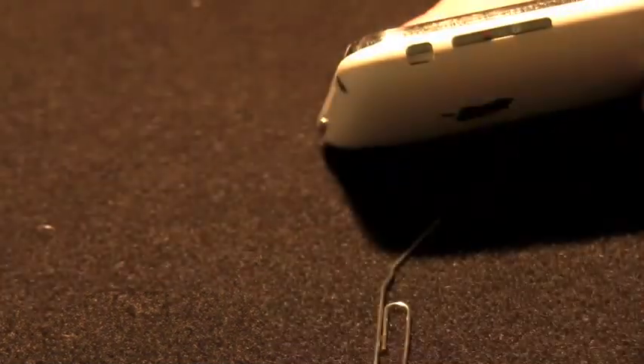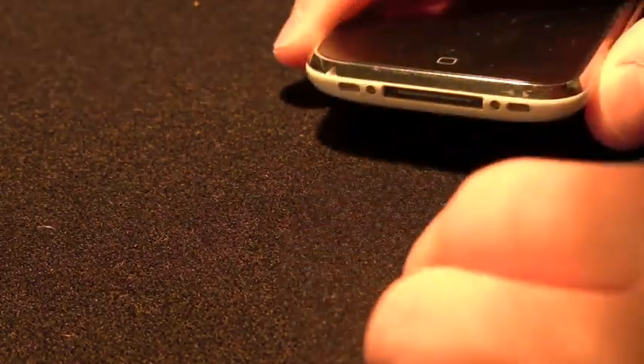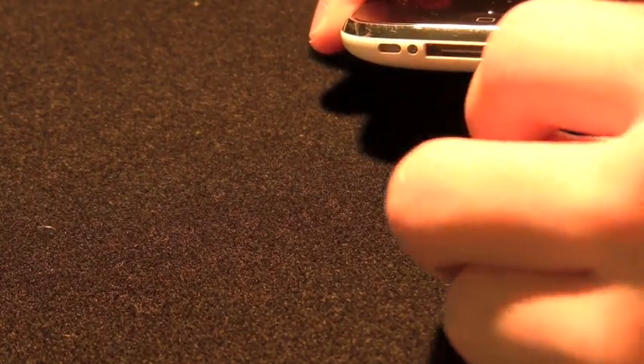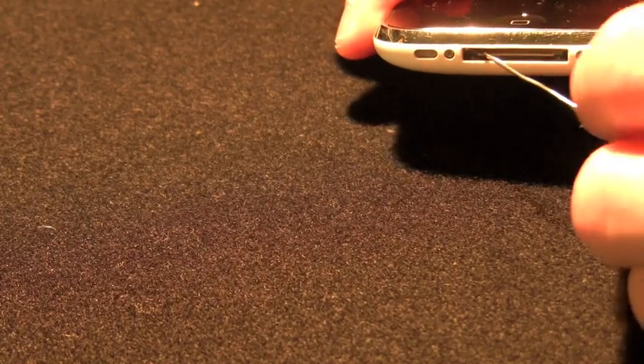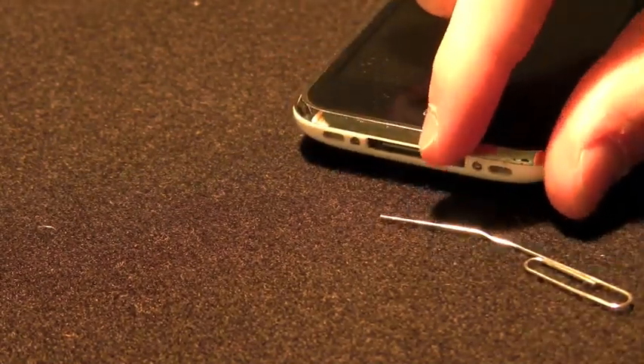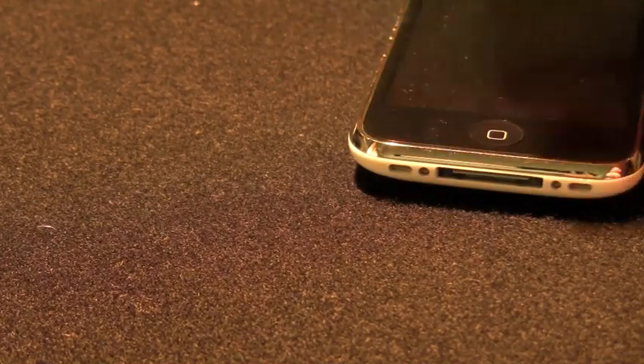The vibrate switch is another area — if you turn it on and off a lot, you're gonna have dirt in that little ledge and along the side. Just take your little tool and saw at it for a bit, then use your microfiber for finishing touches. For the dock connector, you can see the connection port in the middle — be careful not to disturb that. You can go along the top for sure. Take the top and just scrape towards the side, and when you get to the side just pull and flick outward. You'll pull out a lint ball that big — it's disgusting how much stuff gets down there. Don't stick your microfiber in here as you'll just put more fibers down there.